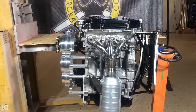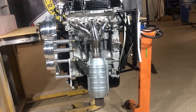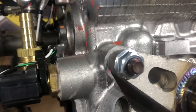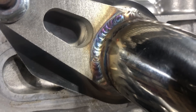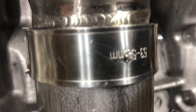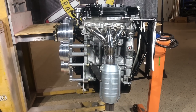In focus right now is the exhaust system — a three-into-one header with a muffler below it. Installation is easy: basically four nuts tightened against the gasket. The welding is very professional. There's a flex joint with a slip joint and a small rivet that keeps the muffler attached to the header, plus supporting bracketry that keeps the muffler from moving fore and aft. It's a very simple system — easy to install and easy to maintain.